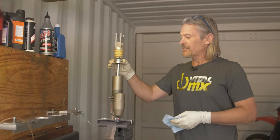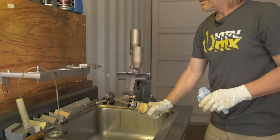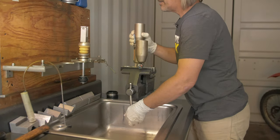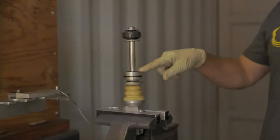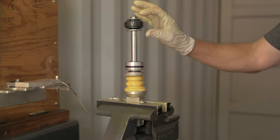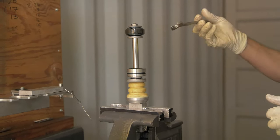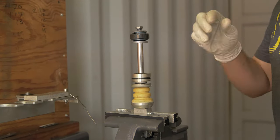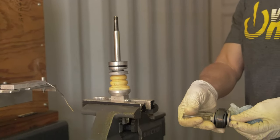Now here's where you're going to make a little bit of a mess, so I have some rags ready. Pull the shock out and let it drain, then take the shock body out of the vise and drain the old shock oil out. In order to replace the seals on the body, I need to remove the valving. This shock has been revalved before so it hasn't been peened on — usually from the factory they're peened on and you have to grind the top of the shock nut off. I'll take all my valving out and put it aside.